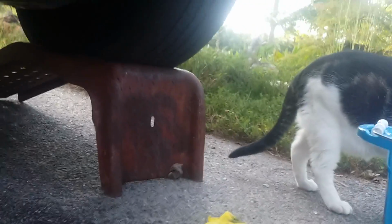Alright, now I let some pressure off the motor. It's actually got a little loose, but it's tight now. It still didn't drop, the motor mount bolt still didn't drop all the way through the hole. So now I'm gonna have to take another jack and I'm gonna have to jack up the cradle a little bit.